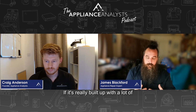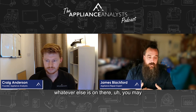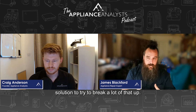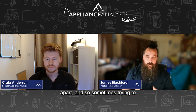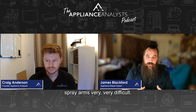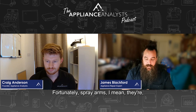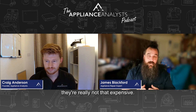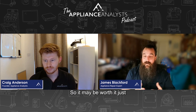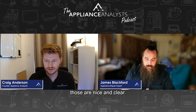If it's really built up with a lot of that hard water buildup or just crud or whatever else is on there, you may soak it overnight in a vinegar type solution to try to break a lot of that up. Unfortunately, spray arms don't come apart. And so sometimes trying to get all of the buildup out of the spray arms is very, very difficult. There are just so many particles that can build up inside. Fortunately, spray arms are really not that expensive. They usually range anywhere from like $15 to $30. So it may be worth it just to buy some new spray arms. Definitely something you could do yourself. Yeah, you want to make sure those are nice and clear.